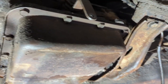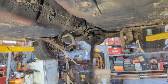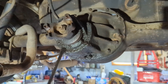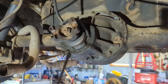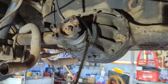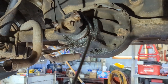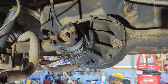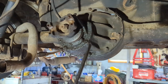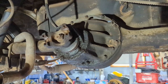This Cruise-O-Matic came out of a parts car and seemed to shift good. What I wanted to talk about is that I think this may be the wrong gear ratio — I need to check, but if it doesn't come out to three-to-one like it's supposed to be, I'm going to pull that carrier right out. I have a spare that doesn't even leak and is tight on the pinion, so I'd just switch it. On the highway this car is turning up too high for a three-to-one ratio. Also, the posi lock is either non-existent or there's something wrong with it, so I'm going to yank it out — that'll delay getting the car on the road a bit.